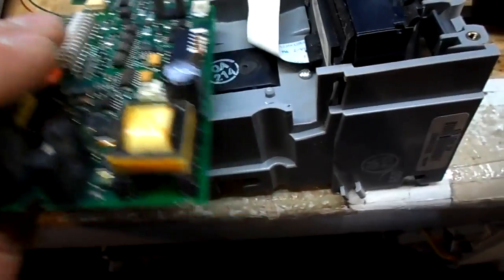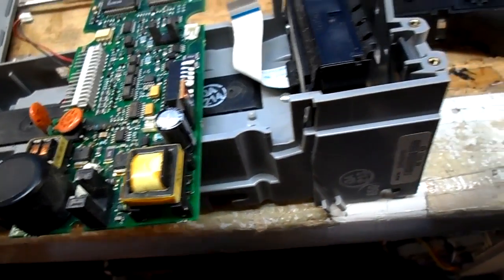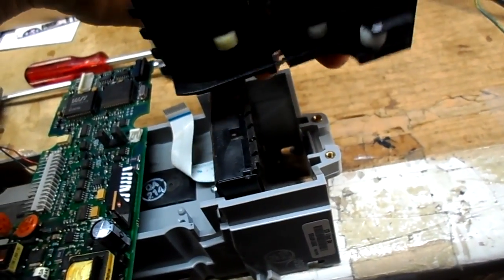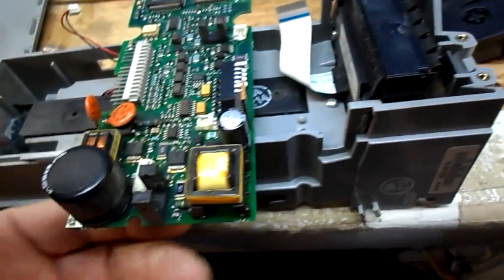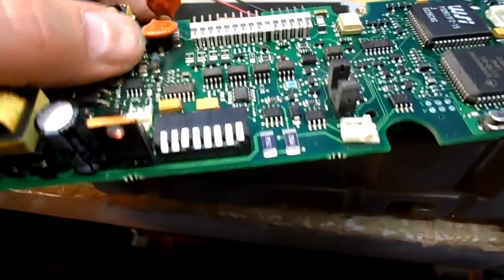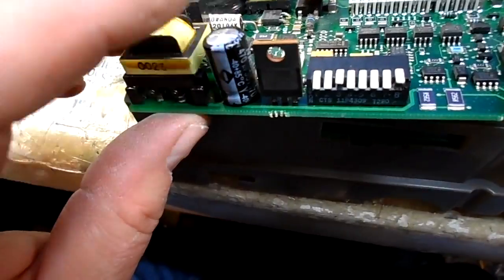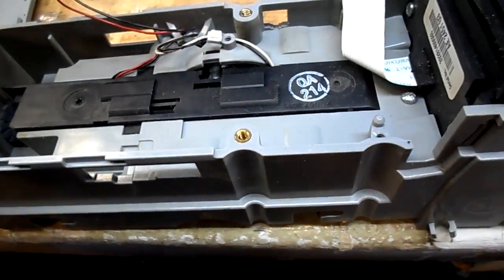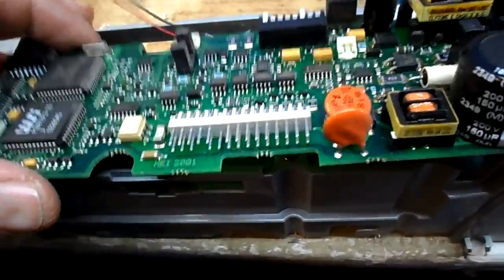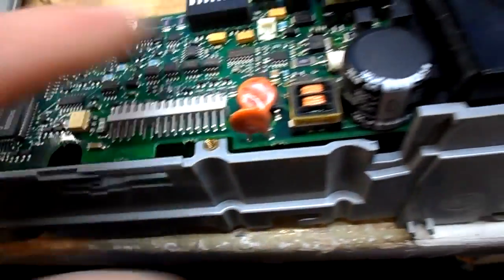We know it's the bill acceptor. I'm going to check the belts — I've gone ahead and ordered a belt kit. But right off the bat, what I think it's not doing is either the optics or the logic here. What I've noticed is there's a fuse under this disc capacitor — that white fuse — but that's fine. I do notice this disc capacitor here is bulged. There are two motors: one is the stacker motor and one is the feed motor. There are no diagrams available, so I'm guessing maybe the one near the capacitor is causing this issue.